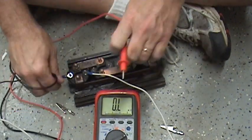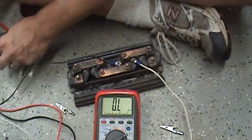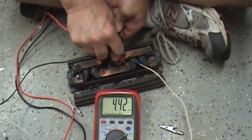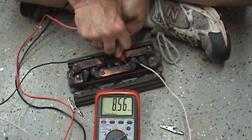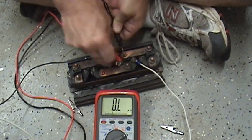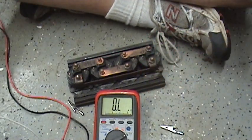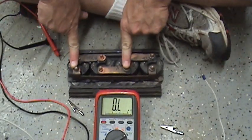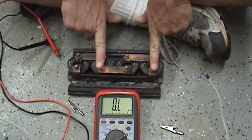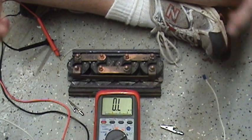This one's got really high resistance. So let's go back to that one — test it again. And again, I've got — well, look at that — it's even higher now: 0.5 million ohms. So that one looks like it's dead too. So this one and this one are bad and need to be replaced. These two are good — these are probably the ones for spooling the cable out. So these two are bad; I need to replace them.